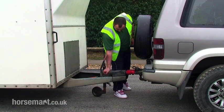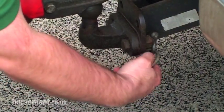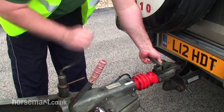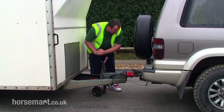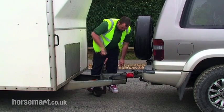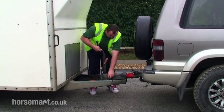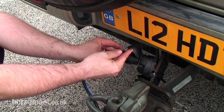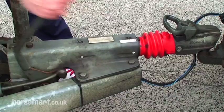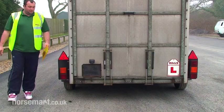After reversing the vehicle back onto the tow bar, put the breakaway cable on first. We'll lower the landing legs and put the hitch on. Improve it by lifting the back of the vehicle up a bit to make sure it doesn't come undone. Now we'll stow the landing leg, fix the electrics, handbrake off, and number plate placed on.